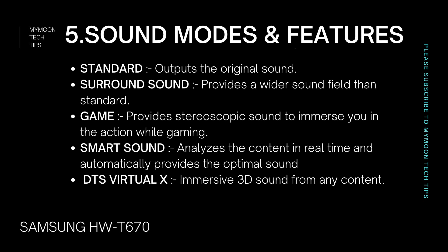The major plus of this soundbar is the supported audio formats. Most soundbars support only Dolby or just DTS or just LPCM, but this soundbar supports all three formats. For LPCM stereo channel, it supports up to 2.1 channel. For Dolby Digital, it supports up to 5.1 channel, and for DTS, it again supports up to 5.1 channel. One important point: if your TV doesn't support Dolby Digital or DTS audio formats, then with stereo or PCM output, this soundbar is going to give only 2-channel output.